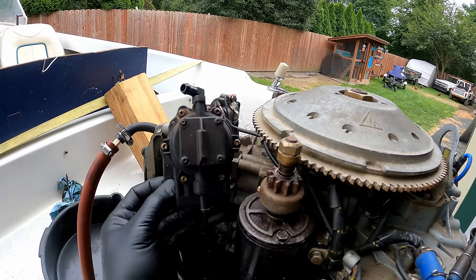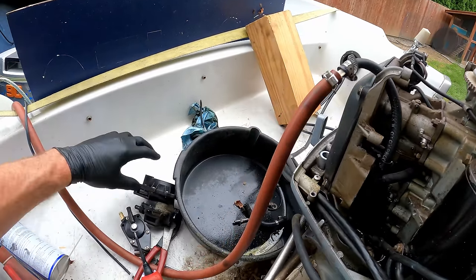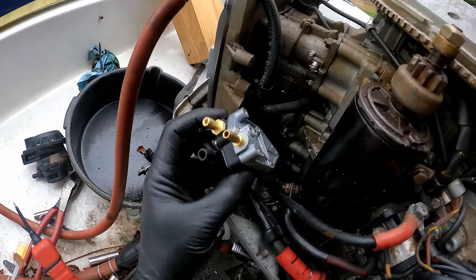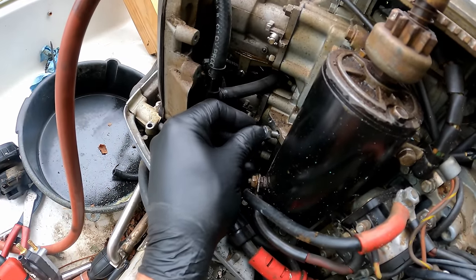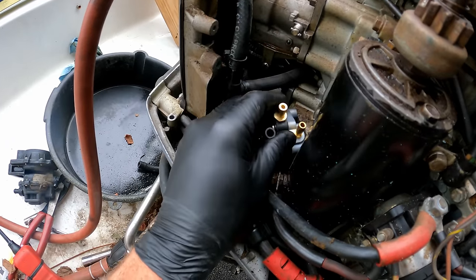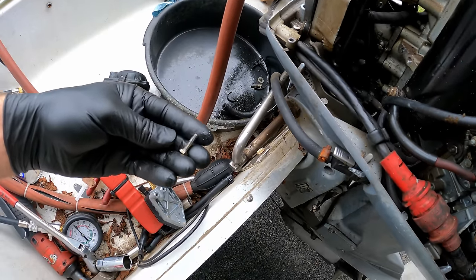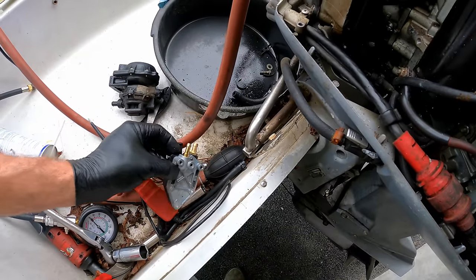And again, we're ditching this VRO pump, the variable ratio oiling system, because that was leaking and I'm not gonna deal with it. I think it's already been bypassed anyway. Got this little guy that will bolt on to the side of the block. See, there was this little nipple on there to send vacuum to the VRO, but this will just go right in its place. And we do need to go find some screws that are longer though. It's the right thread, but not long enough.